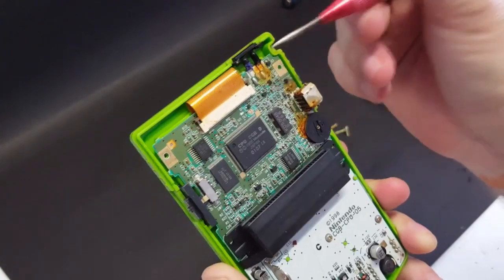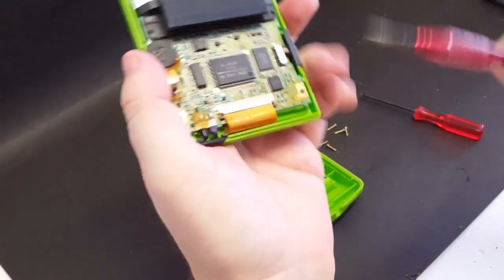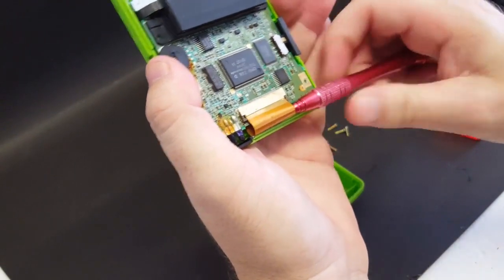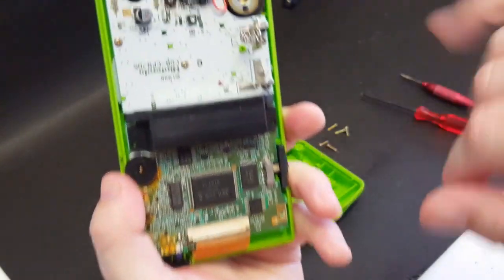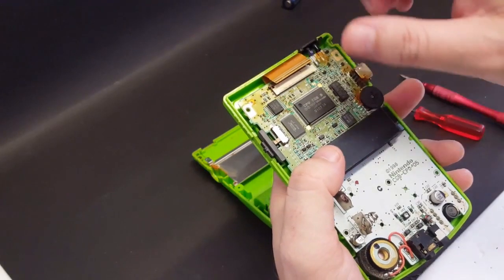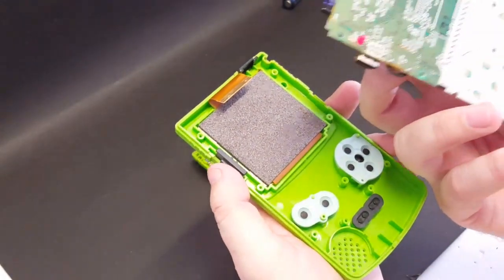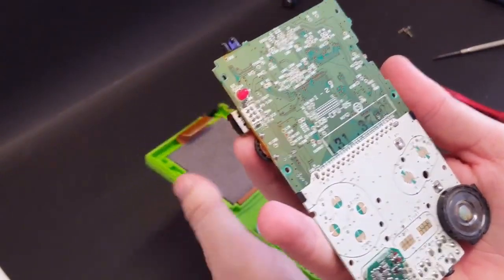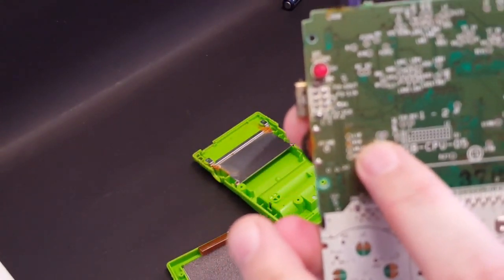And lift up on that, and the ribbon should come right out. Just roll this back. There we go. Now I'll remove the 3 Phillips head screws, and we'll be able to remove the board. Okay, so with the 3 screws removed, the ribbon cable removed, we can simply lift up on the board, and the underside looks pretty good,